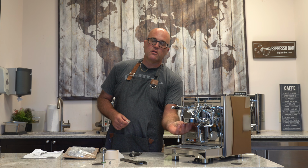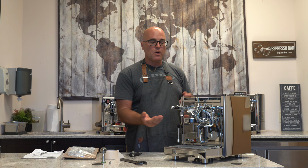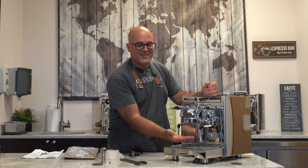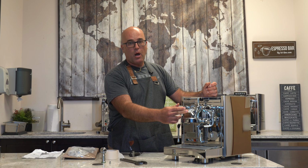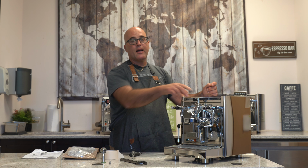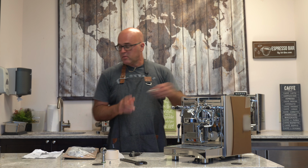A lot of times it's the fineness of the grind, the amount of coffee in the basket, and the tamping pressure that's put into the basket. This measures more so the resistance that's happening here when it's full open. So if you're at, say, 9 bar here and full open, you got a pretty good coffee grind going on there, and you can bring it down to lessen the flow. So just keep that in mind.